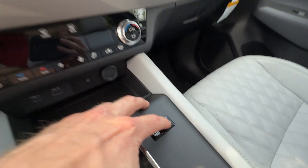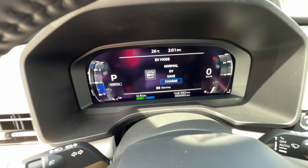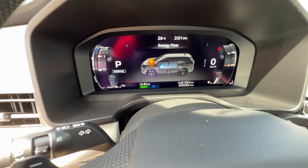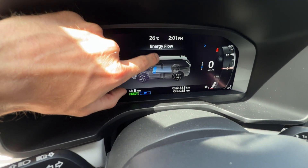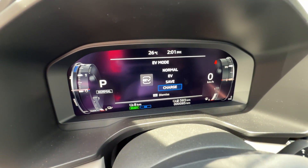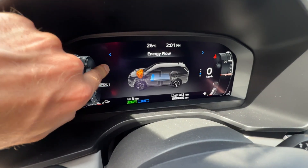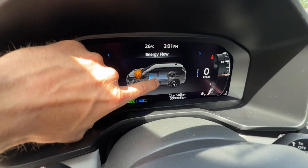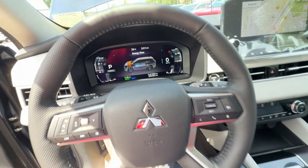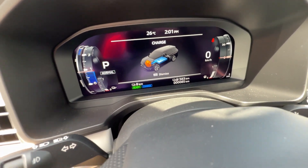If we talk a little more about the EV button, there are a few selections. Normal will just operate as per usual and decide on its own what to do. EV mode prioritizes the EV — right now with EV selected, the engine shuts off because we have enough charge, and the vehicle will drain the battery first then kick in the engine. Save mode lets you save the battery — say you have a full charge and you're going on a highway then back to the city. Since battery is most efficient in the city, you can save it for city driving. And of course, charge mode has the vehicle charge the battery itself. Pretty cool technology.